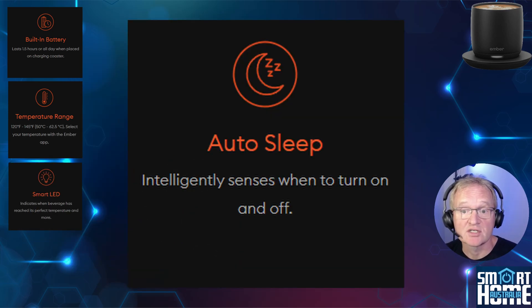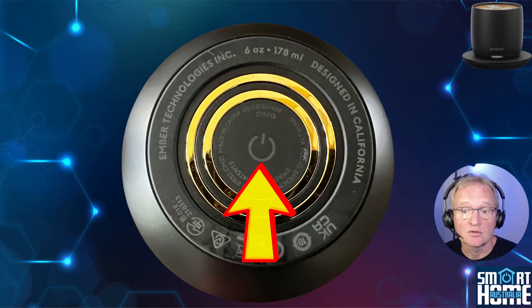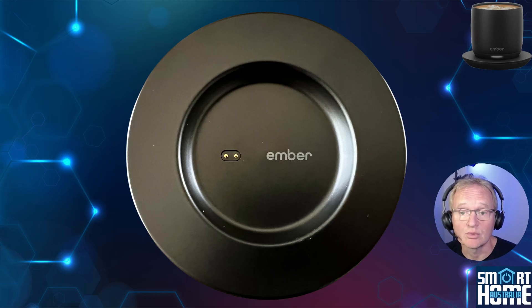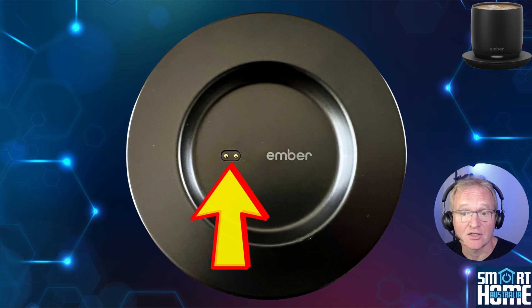As you would expect with a smart cup, it comes with various smart features. The cup will enter sleep mode when it's empty or after two hours of inactivity, and will wake from sleep mode when the cup is either moved or liquid is poured into it. On the bottom of the cup is a single discrete button that can be used to turn the cup on or off, plus cycle through available temperature settings. The coaster is simple and stylish, allowing power transfer to the cup through two power pins that connect to two concentric conductors on the base of the cup.